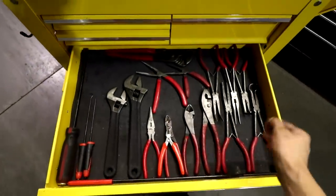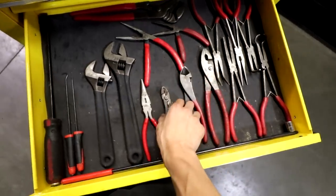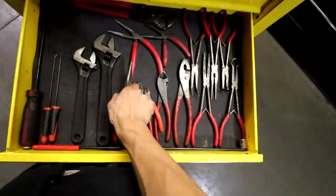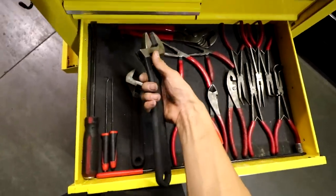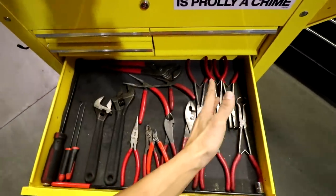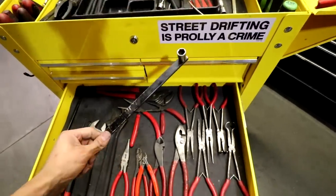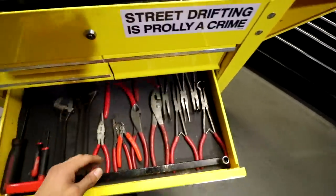Going down to the next drawer — this is basically my plier drawer. I recommend having an assortment of needle nose pliers, a set of dikes, a set of electrical wire strippers and crimpers, flush cut pliers — this one's actually from my vape rebuilding kit but works really nice for cutting zip ties really flush. Adjustable pliers and a crescent wrench — I really use these a lot when doing alignments, just set the toe and let it go, adjust those tie rods. Just a nice assortment of pliers is definitely crucial. Also a couple picks, a mid-sized pry bar, and a serpentine belt tool — this is really nice because you can put any size socket on there to get into tight areas to crack that serpentine belt loose.